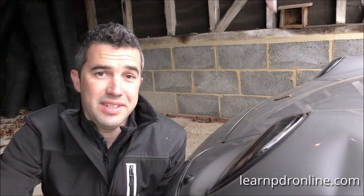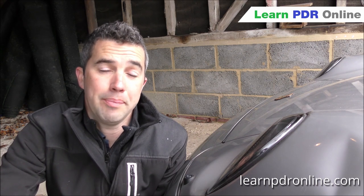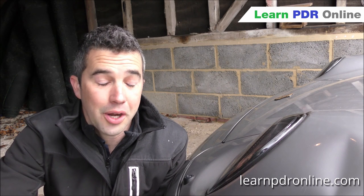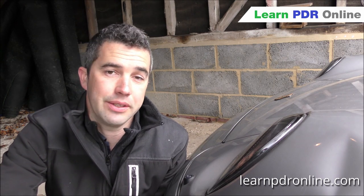My customer has been quoted £700 plus VAT from a local body shop, and the body shop advised him that it was the best way to go over paintless dent repair. That's simply not true — paintless dent removal is the best way to remove any dent damage that hasn't marked the paint. Otherwise you're talking about taking the paintwork off, having to fill the panel, prime, paint and lacquer, and you can never beat the original manufacturer's paint. By taking this dent out today, not only are we going to save our customer a lot of money, but we're going to keep the integrity of his vehicle. I'm really hopeful we're going to get it to 100% — it looks fairly straightforward at this stage.